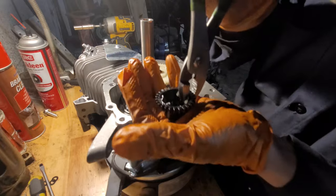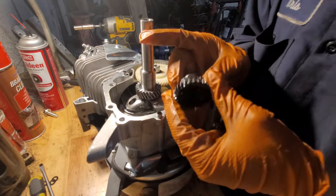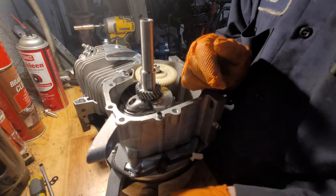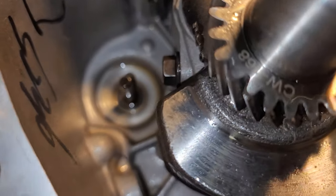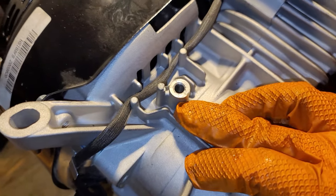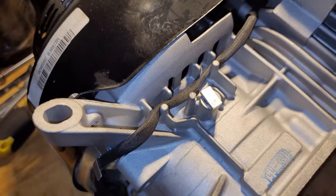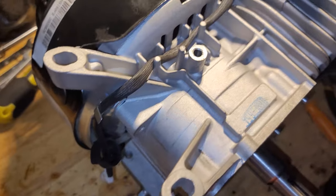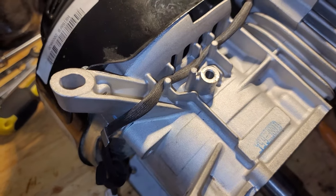With a punch tool, I was able to spread the ring a little bit into the sides. This is pretty much as open as I can get — let's get a pick tool so I can hook it and pull it out. After a little battle, here we go — here's our wheel. This little thing is responsible for all the issues we're having as far as RPMs not going above 3000, or whatever the rev limit is on this engine. There's a washer right there which we have to remove — don't forget to remove that washer. Next step is to find a bolt we can put in here, with an O-ring or rubber washer so the oil doesn't spill out of the engine.